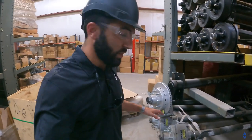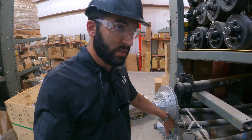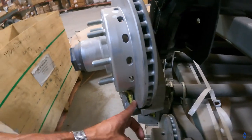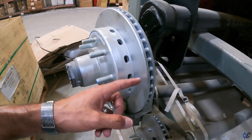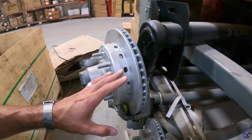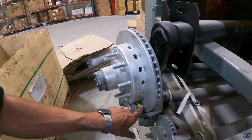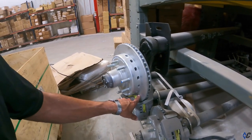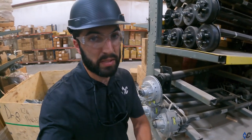It's not rocket science. If you want to maintain your equipment, you have to check it often to stay on top of those pads and keep them replaced. Because what happens is you wear down the brake pad and it starts squeezing metal to metal on that rotor — it will start eating the rotor up, costing more because you have to replace it. Sometimes if you catch it soon enough you can have the rotors turned, but ideally you want to stay ahead of those pads.